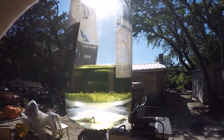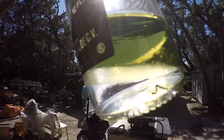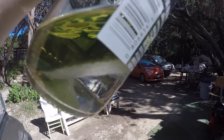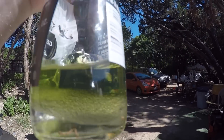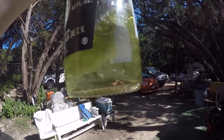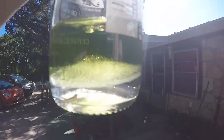I'm putting a little bit of water in here and as you can see, the water is more dense. Gasoline is about 0.6 to 0.7 grams per milliliter, while water is about 1 gram per milliliter, so it's going to sink to the bottom. The part of your car or motorcycle that sucks gas is at the bottom, so whenever that water is at the bottom you're getting straight water and no gas. The best way to fix it is just to drain the old gas and put new gas in, or take it someplace that'll do it for you — it's not going to cost that much.